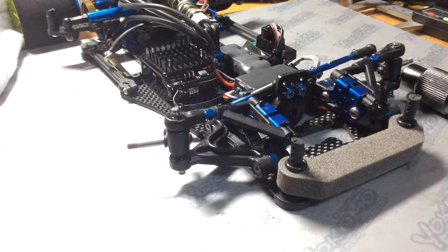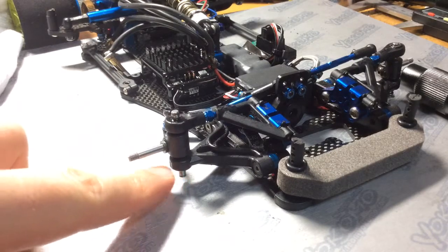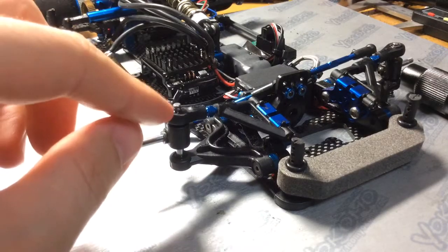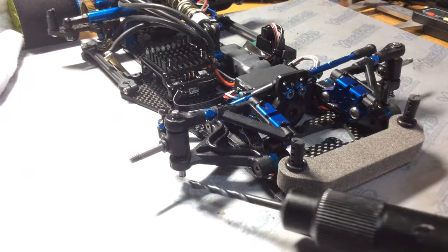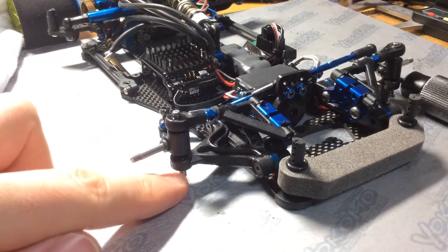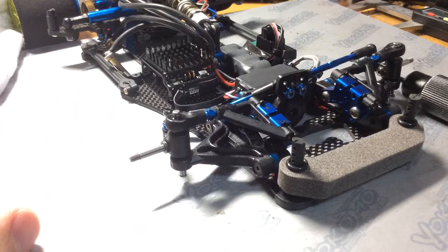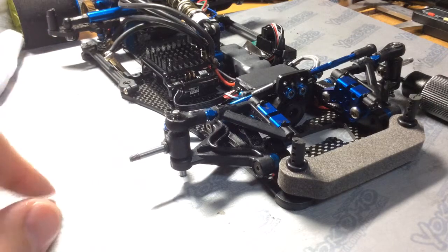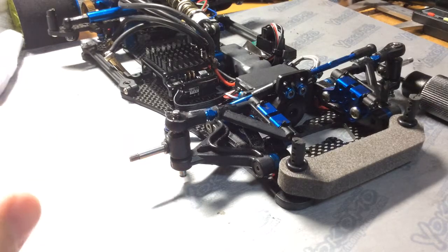This is just for demonstration purposes. Just put your spring on, add everything on there, and you should have a relatively smooth dampened kingpin setup. Whatever you do, don't just add kingpin lubricant right where the spring is, because a lot of tire debris, dirt, whatever it might be, will gum up in that area and stick to the spring and affect the spring reaction. Make sure you don't put globs of kingpin lube on the spring itself — you want to make sure that spring is clean.